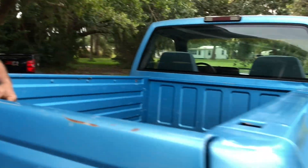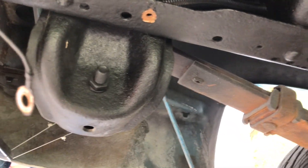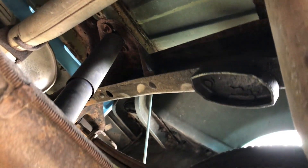We're over at Pappy's house. He's helping me out since I don't have a hoist or anything. Your bolts are going to be underneath here. You'll see the big holes where your ratchet is supposed to go through — that's where the bolt is. You can tell I did some rust repair over here already, but there's one on the other side. There's a ground bolt you're going to take out, and a ground wire. There are eight total, all 18 millimeter.